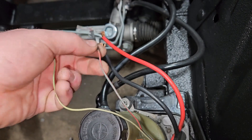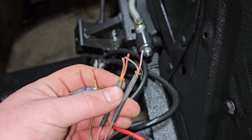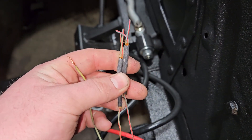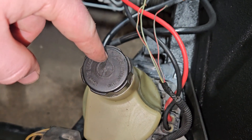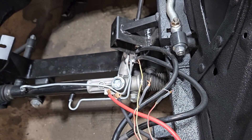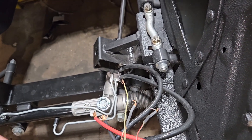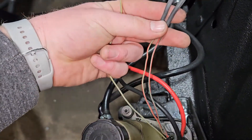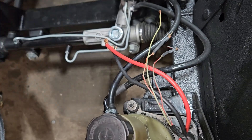These are your CAN bus wires. I don't know if we're going to use these or not, but like I was saying, these can go to a GPS controller so that way at 60 or 65 miles an hour this is only at 60% duty cycle, not 100%, making it firmer. On eBay they're about a hundred bucks. We're going to try it first without and add that later if we need it.